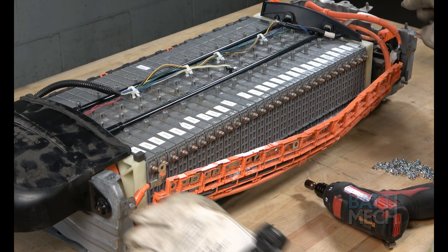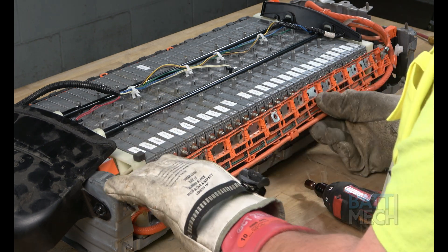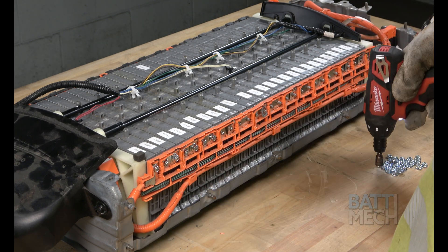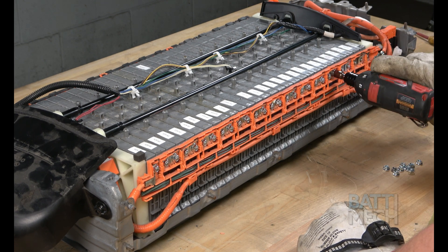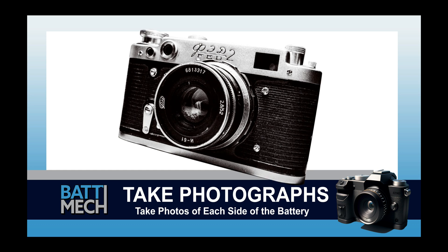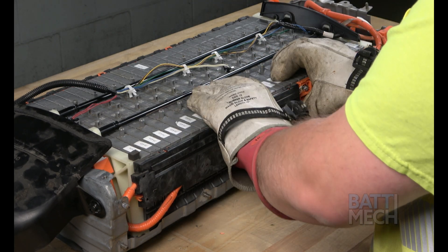Now go to the opposite side of the battery and repeat the last few steps. Start by attaching the orange wiring harness to the battery modules using the BATMEC supplied nuts. Don't forget to attach these two essential eyelets to complete the circuit. Once the two essential eyelets have been attached along with the orange wire harness, go ahead and apply the nuts. Remember your torque settings. Now is a good time to take a photograph of each side of the battery — these photographs can be used for review of assembly if you experience issues, and may save you from having to uninstall the entire battery later. Now that you've attached the orange wiring harness and taken multiple photos, reattach the black harness covers to the side.